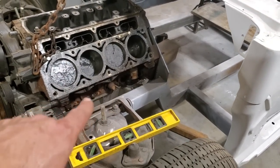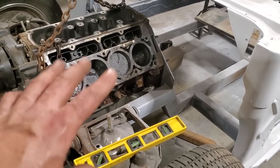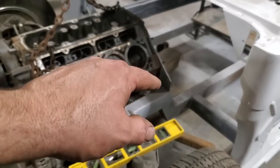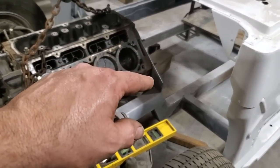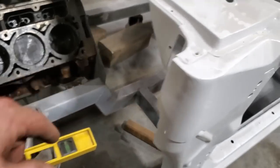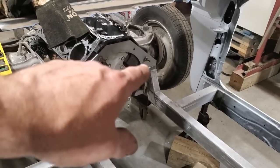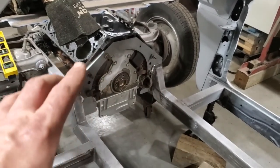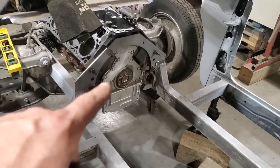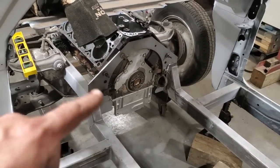I'm going to see if I can pretty them up a bit and have them so that they bolt on there, get that ready. I'm not going to weld them on yet because I got to take the mid plate off. I'm going to weld that on first, but I want to set all that up and check it. Also, I do have clearance for the transmission. I was concerned about that. The transmission is narrower than in between them two plates, so that is fine. So everything is good. So I'm gonna go ahead now, make them two plates, and get this all ready to put together.